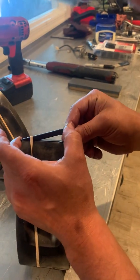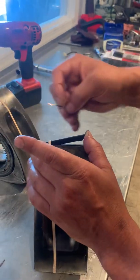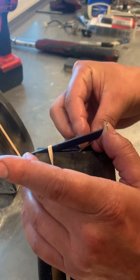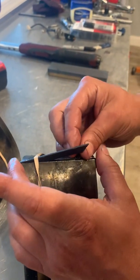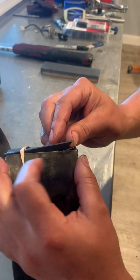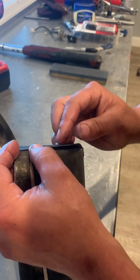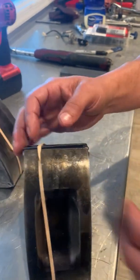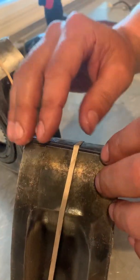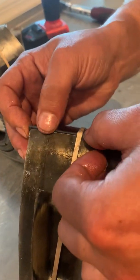Then you slide your big spring in all the way until it stops, like that. Take the short spring — and be very careful here to make sure that you put it in the groove. You can see where the stop is right here on the spring, just like that. I try to put it as close as I can to make sure that it's in on both sides, and you want to make sure it's not too far that way. Now not only is your seal in and ready to go, all you've got to do is put your little corner piece in once you put your rotor in, but you can check and make sure you have no binding on your seal.